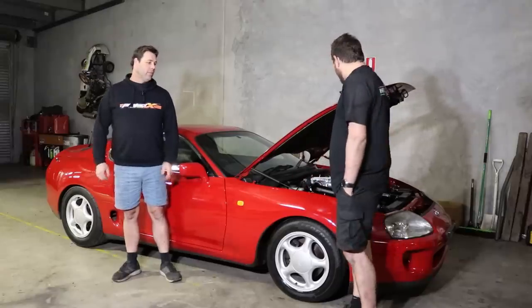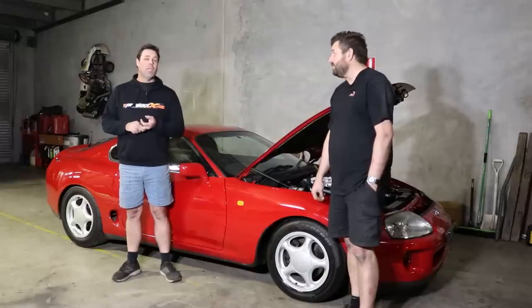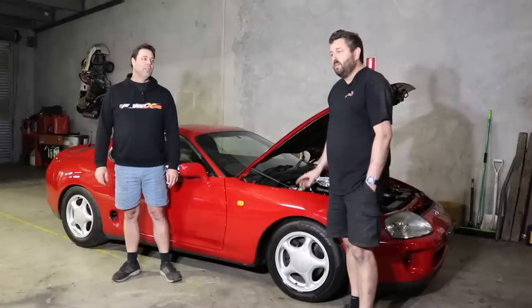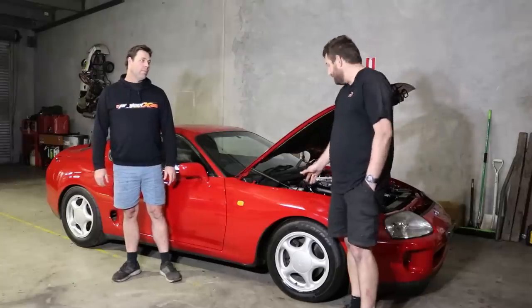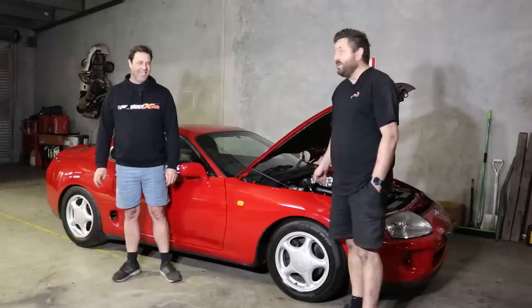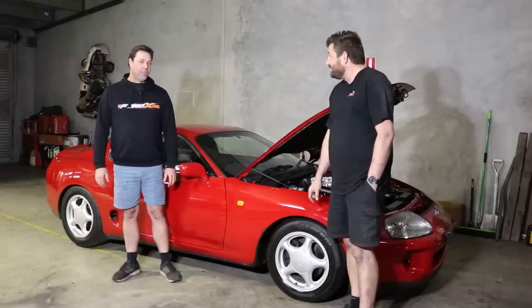So tonight we're going to basically run it on 85% ethanol. Or 80% ethanol. These injectors are 850 to 1150s, so I'm running about 75 pound base pressure. So a limiting factor. It's probably going to limit that, and just in case it gets close to something impressive, I changed to a wet nitrous kit. Idea is I've got enough pump, I can add 100 horsepower worth of fuel with the nitrous. I shouldn't do it, but that's what you got to do sometimes. It'll be right, it'll be fine.